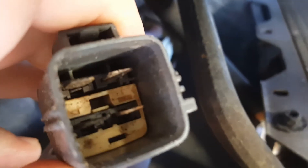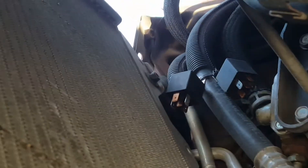Another important thing other videos aren't showing you — this is a 2008 model. See what the plug looks like? There are different plugs for different cooling fans. This one has like four prongs in a cube shape. The other one, I think from 2000 to 2006, has a three-prong cable — I could be wrong on that, but you need to make sure you get the right cable. I got my fan on eBay for a 2008 for 53 bucks. I think it was going for like 120 at the auto parts store. I want to show you one more plug up here — that is also one of the plugs. The cooling fan I got came with that plug already on it, which was really awesome.